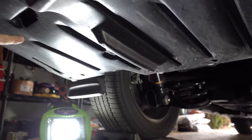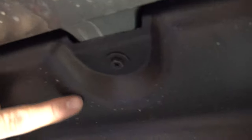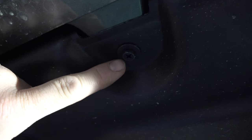Under the van — here's the rear bumper up here — we have to remove this plastic cover which encompasses the whole back side of the van. You're going to find several things. First, there are some 9mm screws. You can take a socket, a wrench, or I have it on my drill. Take all those out first.